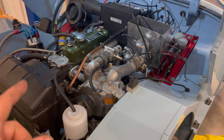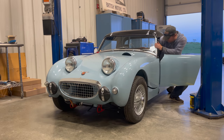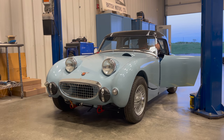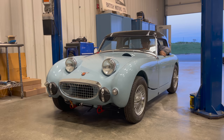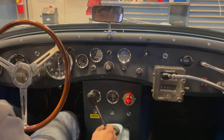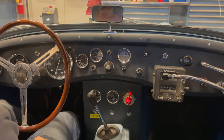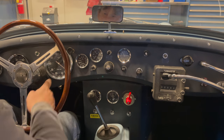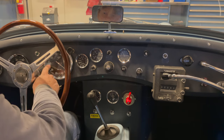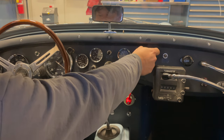So I think what I'll do right now is back this out for the first time and see if it drives okay. Here we go — turn the main power on, then turn the ignition switch on. We'll see the tach cycle. There's a telltale and that should come back down — it will report the maximum RPM that we hit. Now we're ready to start it.